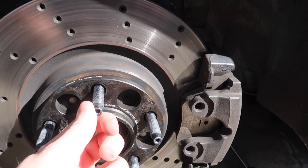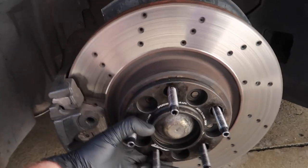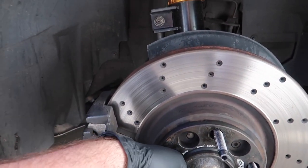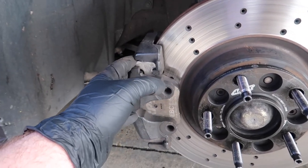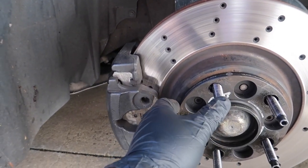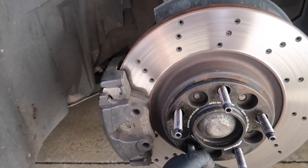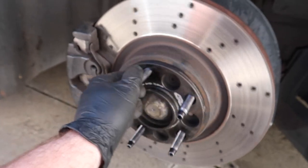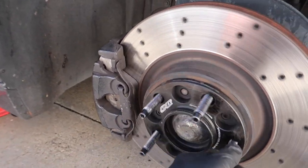They kind of tap against the rotor — not the best noise, but they're race pads so you can't really complain. On this side it's super apparent — I'm putting good force into it and the pads are just dragging. I don't know how I forgot to compress the piston all the way, but I was in a rush at a friend's shop. Now I'm taking my time and checking over everything twice so it won't be dragging anymore.